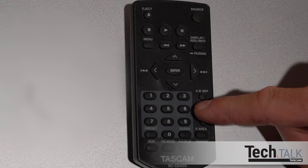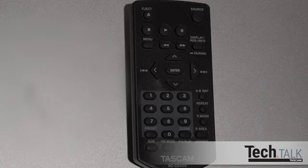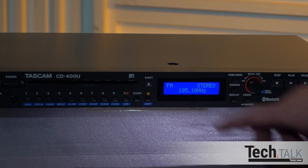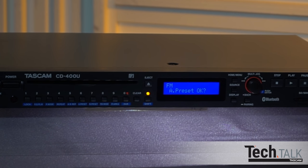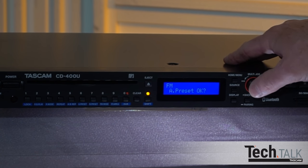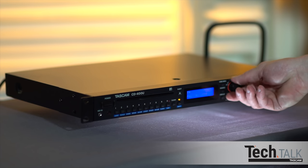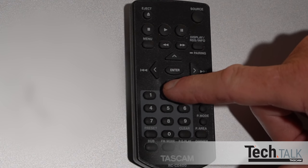The remote has dedicated repeat and P mode buttons and performs the same functions. In AM/FM modes, you can set presets. Press shift and A preset — which stands for automatic preset — then press the multi-jog dial knob in. Up to 20 presets are automatically saved. Choose them by turning the multi-jog dial, or use the remote to select presets by pressing the up or down arrow buttons.